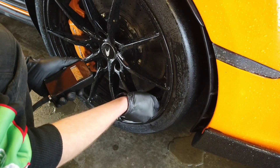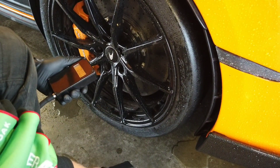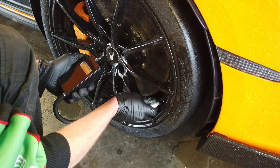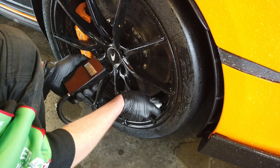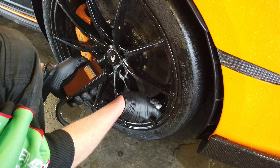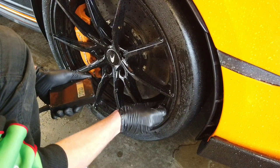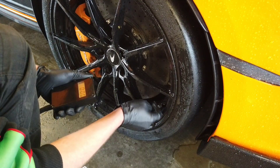Next up is tyre pressures. A lot is said about tyre pressures. Generally speaking, we will drop tyre pressure down between 6 and 12 psi during the course of a day if it's a hot day. Our advice is always to start on standard tyre pressures and drop accordingly as you go. You will get car alarms on the dash — ignore them. When the tyres raise up in temperature on track they will go up again. Just remember to put them back up when you finish the track day, going up towards the end of the day to make sure you're safe going home.